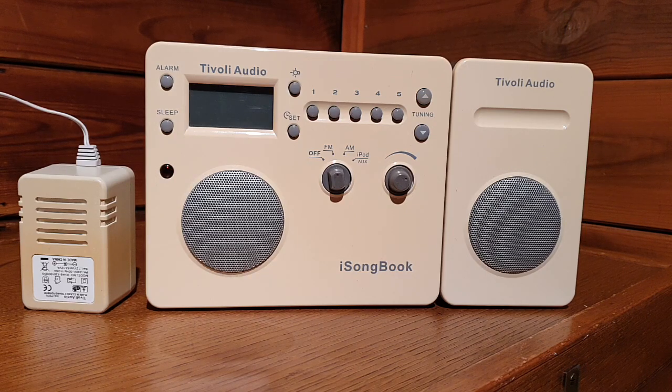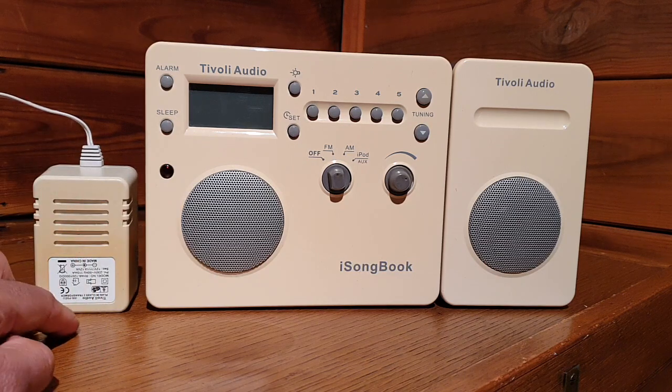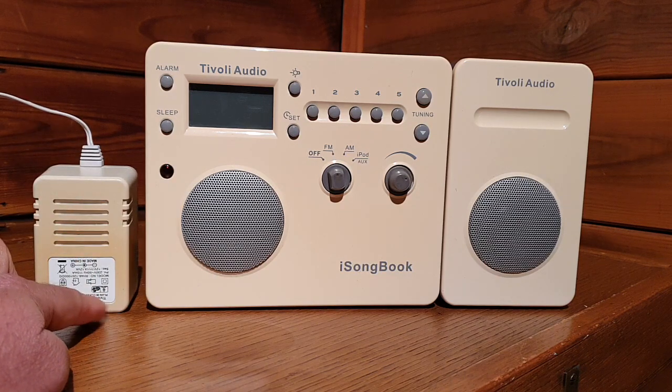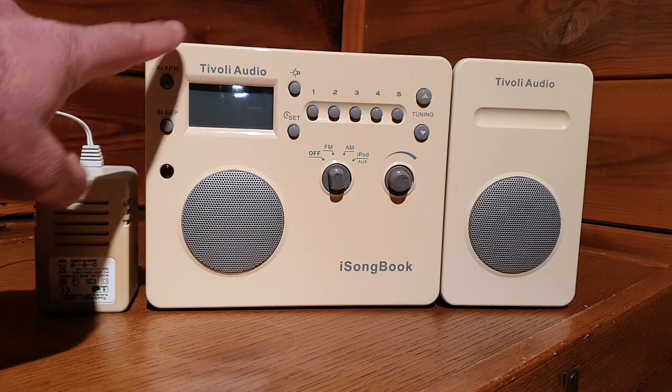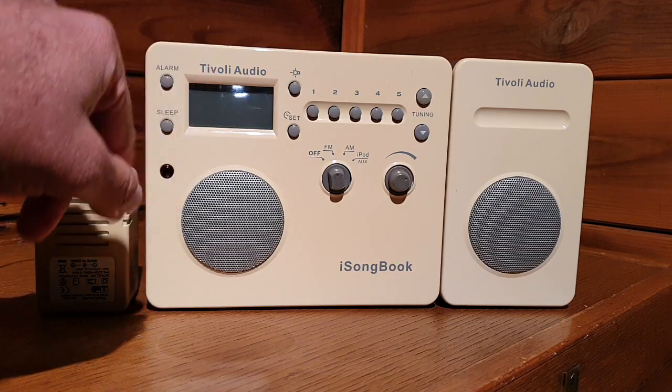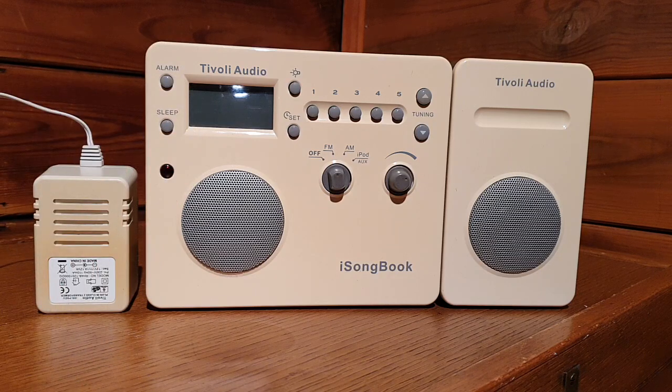Here they changed a little bit and came up with a little bit of a new idea. So it doesn't have a 220 volt power, but it has a power supply with 12 volt, 1 ampere current like this, and instead of analog tuning they come with a digital PLL synthesizer tuner. So then you have an accurate frequency, and it's stereo.